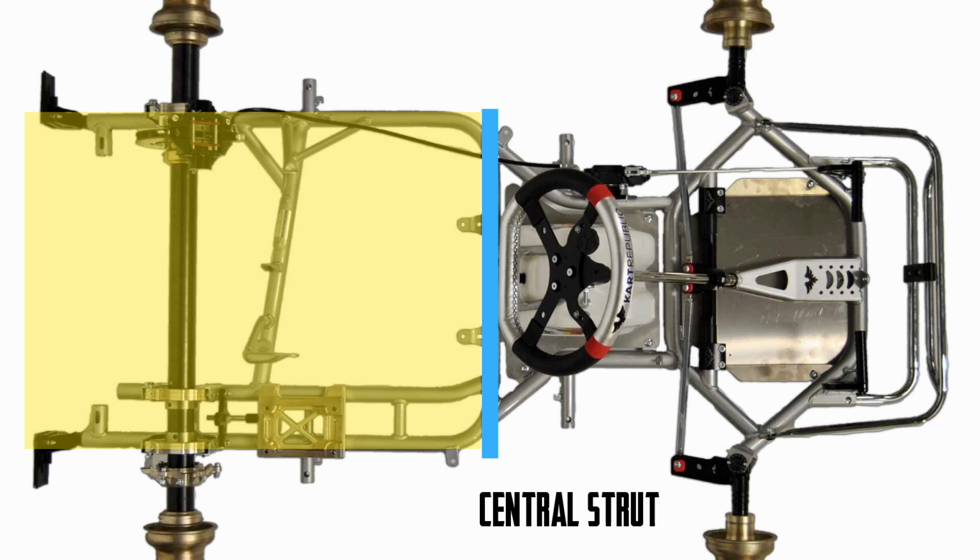The issue here is you're not allowed to extend it via the floor tray, and if you bolt any sort of flat floor to the chassis, it would, in my view, suddenly be defined as bodywork, and bodywork is subject to mandates and homologation. So if you bolted anything to the chassis itself, you would find yourself in trouble with the regulations, in my view. If, however, you change the seat to additionally include a large flat surface underneath, then in effect you get the same effect as extending the floor tray or bolting a flat floor straight to the chassis.